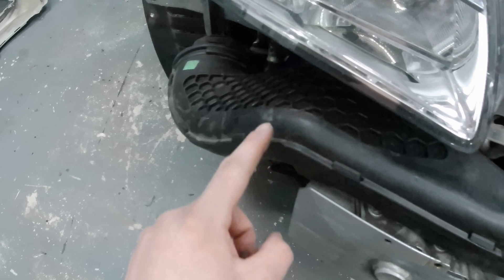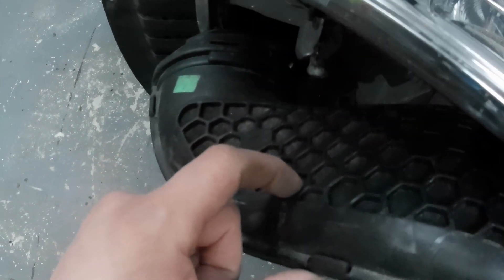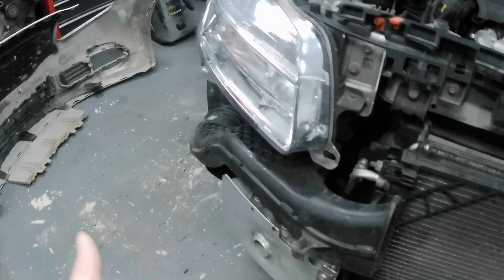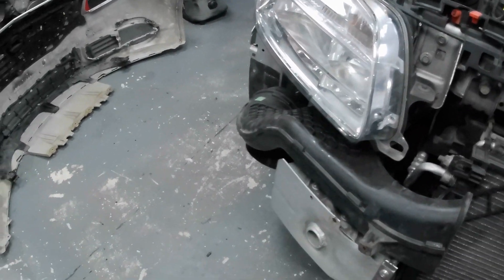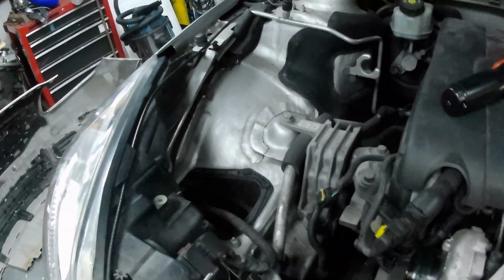Quite a complicated inlet system. This was covered in like a wrap, even though that's like a foam membrane there. And basically the idea that I wanted to do was simplify the intake and hopefully get some ram air, so that when I'm going 50mph there's actually some pressure coming in into the air box and helping the turbo.